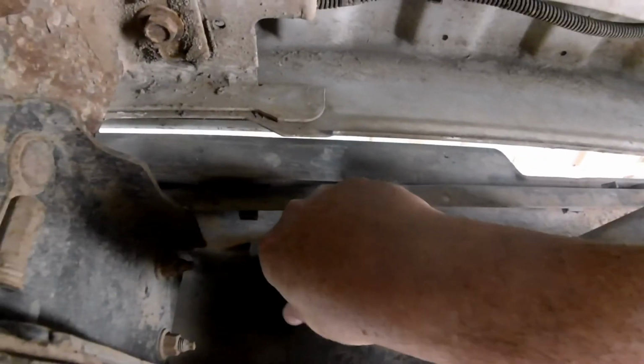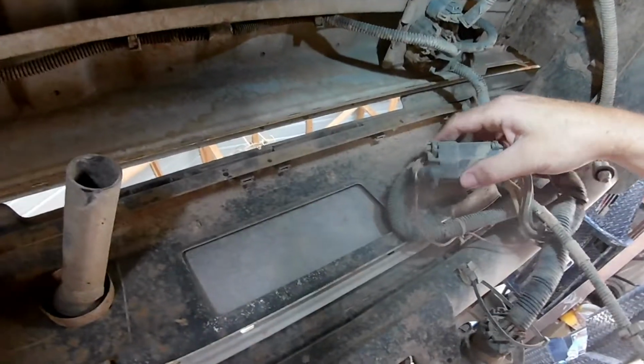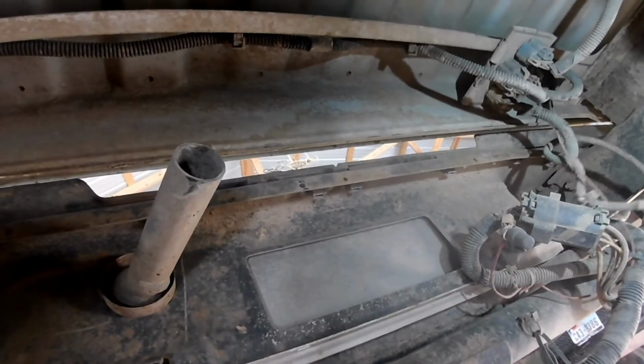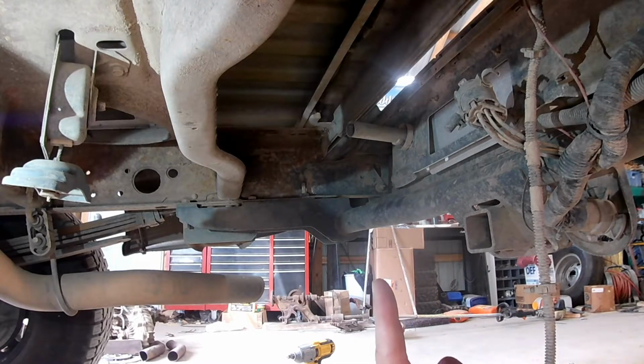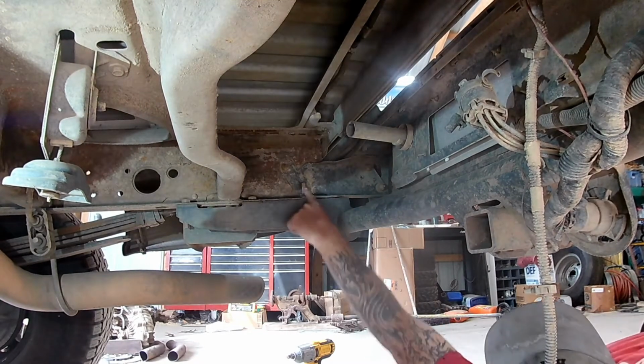Okay. The license plate lights are in here. They're usually just a quarter twist, and they come out. I got them on both sides already. I got to cut some zip ties for the trailer stuff. And then I think we're ready to start unbolting stuff. So let's see if we can get this done. Looks like we've got one up through the top of the hitch over there too that I didn't see initially. This guy.